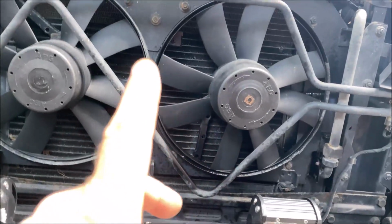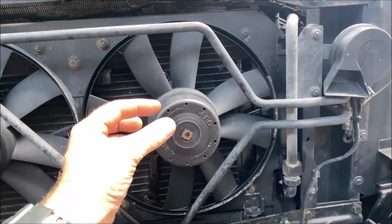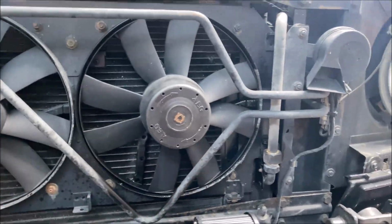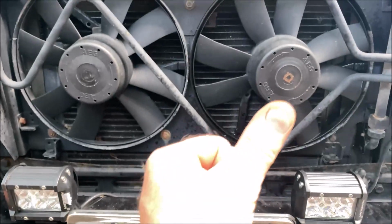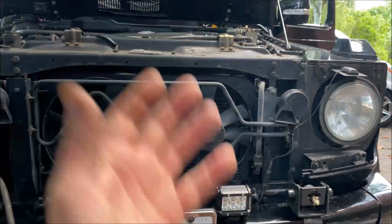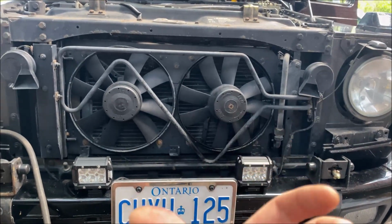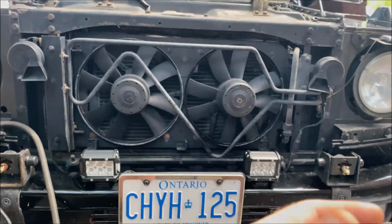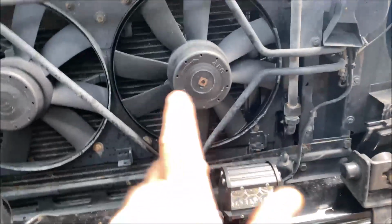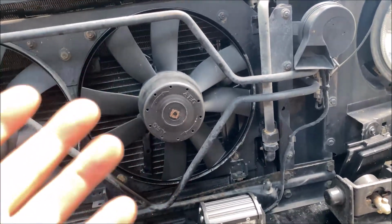Anyway, to fix that, because like I said, I could push on it a little bit, which changed the positioning of the brushes slightly to a cleaner spot where they would engage and go. So the first thing I did was take a rag with a blob of grease on it and hold it against the center of the fan when the engine was up to temperature. Turn your air conditioning on full, that'll help it get up to temperature. And when you're pushing on it, you don't want to do it with your thumb because it will burn your thumb in about half a second because it's spinning so fast, the friction. So you use a glob of grease on a rag and push it in, and then once it gets spinning, it should clean itself out of the carbon tracks. The spinning motor should. If it doesn't, you might have to replace the motor, but mine in this case did work.